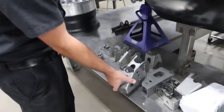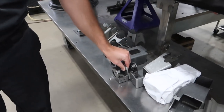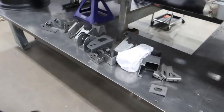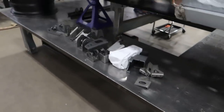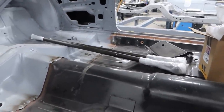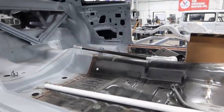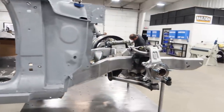We've got different coilover mounts to work with — upper mounts, lower mounts that could be mounted vertically. You basically start fitting stuff and see what packaging you have and whether the link angles make sense at the right height. The kit also includes a universal link — a four-foot piece you can cut anywhere you want and weld in, giving you a swivel link at whatever length you need. It's a fabricator-level kit you can adapt to pretty much anything.